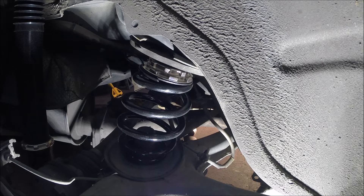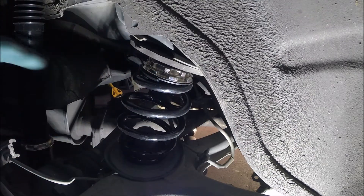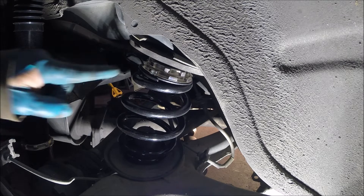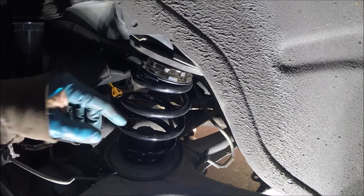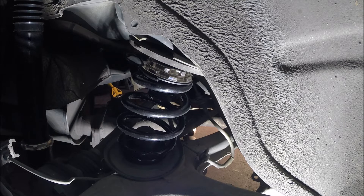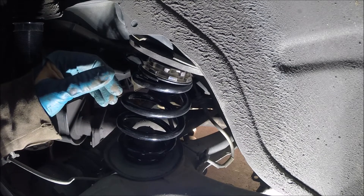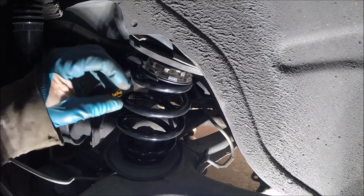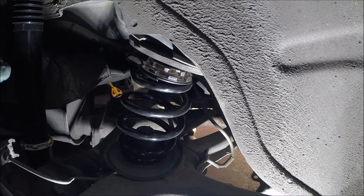The rear is a bit different — this is a much more indirect link between adjustment and the hub because it's kind of halfway between the fulcrum point and the end point. The other side was at 338 millimeters, so as a starting point I did three turns down on the lower locking collar on the spring and then nine turns on the shock — since for every one turn of the spring you do three turns on the shock. That side ended up at 348, so for this side I'll do two turns on the spring collar and six turns on the shock.